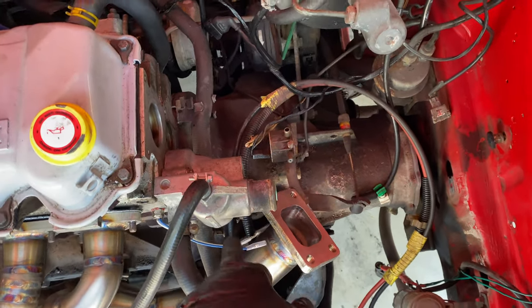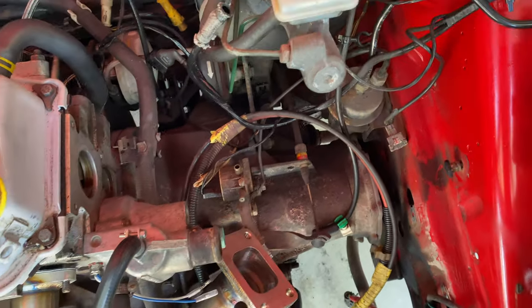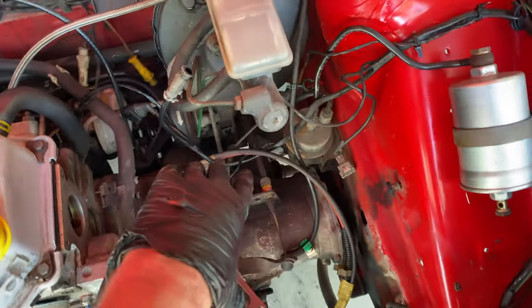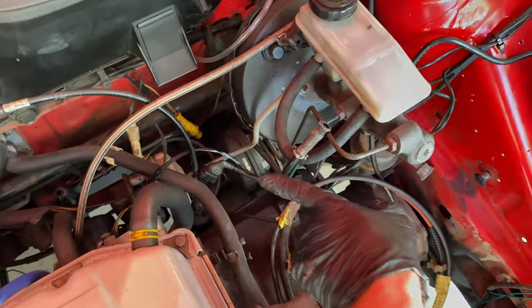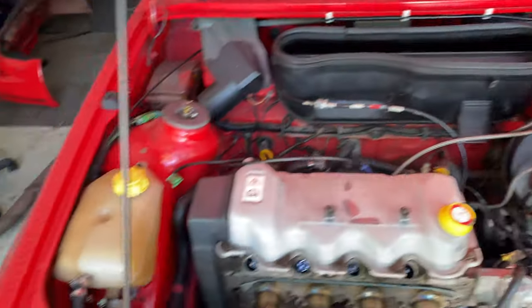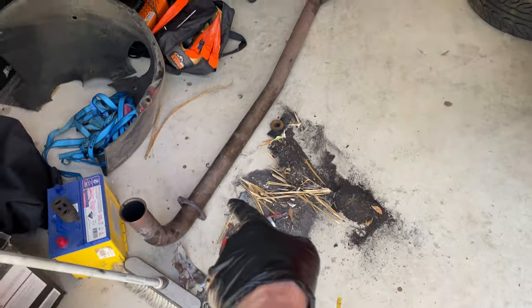This, as I said, is going to be moved to this side here — just going to be blocked off there and put on here. The ABS system is going to be gone and the turbo sits here. Air filter this way, and the downpipe is going to go down there to the back of the car into the three-inch Scorpion exhaust.